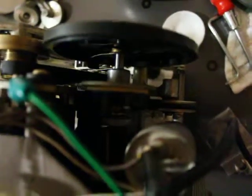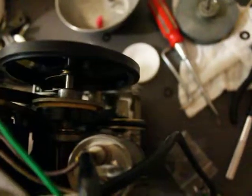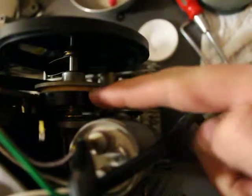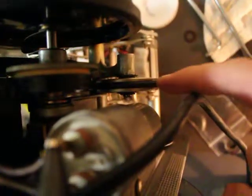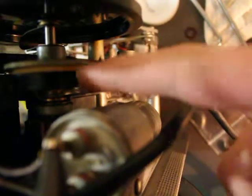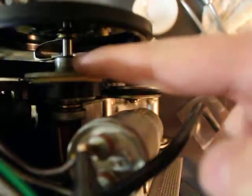The main thing that I was having problems with is this piece down in here. That is the clutch — the playback clutch. What should happen is this black plastic piece comes in contact with this belt. This rubber belt contacts this black piece, and this should slip on this felt, on this metal ring here.